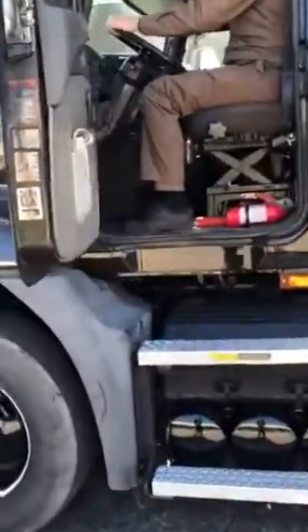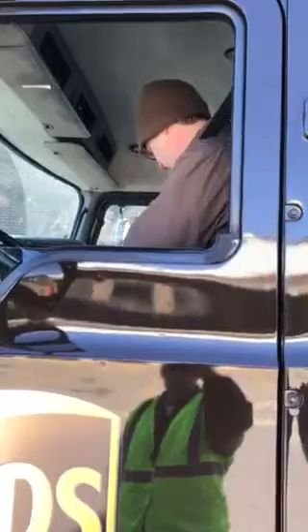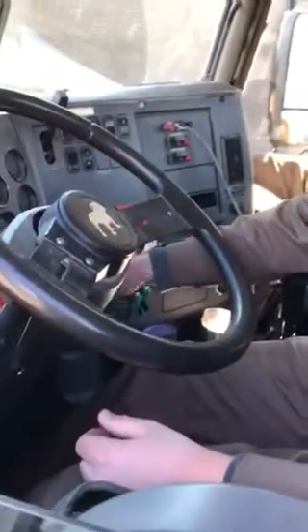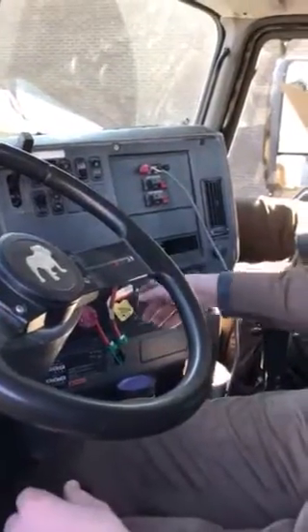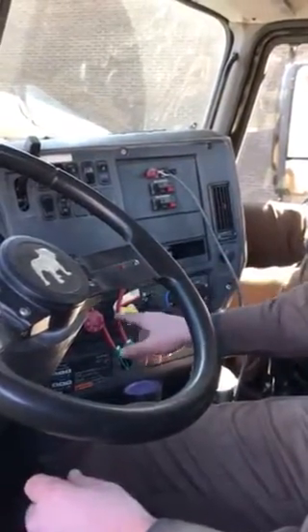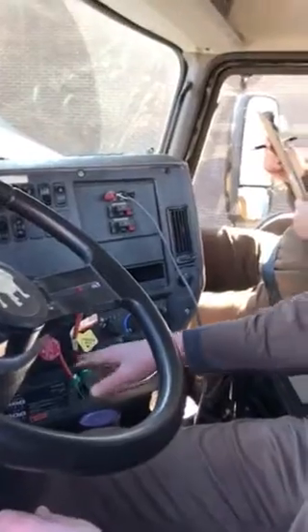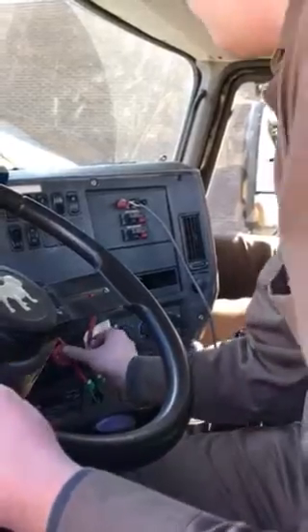Tractor park brake applied. Transmission in neutral. Check my seat belt — no cuts or frays, buckle is fully operational. Release the hand valve, insert key, start the engine. Check my air pressure — press the clutch and cover the brake. Air pressure is at 90. I'm going to do a low air warning test — as I begin fanning, I'm going to push both trailer brakes in. At 60 psi, or half the governed air pressure, the audible buzzer and visual light on dash warnings will be activated. At 45 to 20 psi, the trailer air supply will pop out first, followed by the tractor park brake, which I will verify by pulling on the valve.